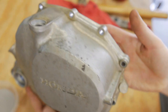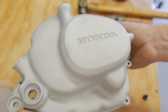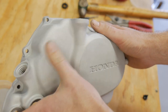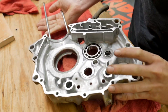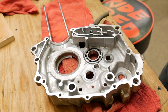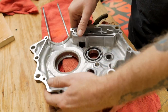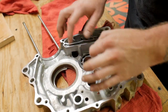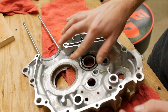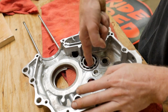This is what it was like before, and that's after — I haven't washed it yet, but it's a good surface to paint on. I washed these cases out real well and wanted to inspect these bearings. I don't plan on replacing every bearing just because I'm here. Some of these bearings just feel brand new. This one you can hear — it has no oil in it whatsoever — but it feels brand new, like a cleaned-out bearing. I don't feel any roughness, I don't feel any grinding, I don't feel anything at all.